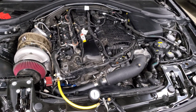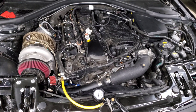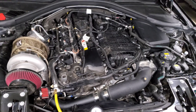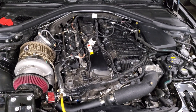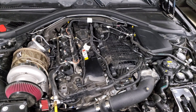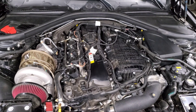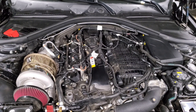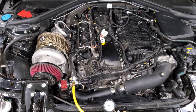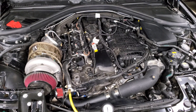I want to give a big shoutout to Marin over at Marin Tuned — he's the one who walked me through this initially when I was trying to understand high pressure fuel pumps and why certain fuel pumps needed settings adjusted compared to others. Hopefully this helps you guys understand why certain fuel pumps need their settings updated and how a high pressure fuel pump works. This also explains why the TU pump doesn't need to be modified, because the way the adjustment works matches the OEM fuel pump — no settings need to be changed there.